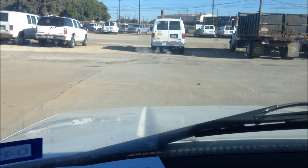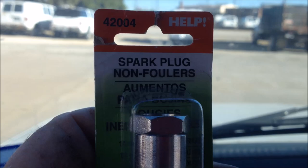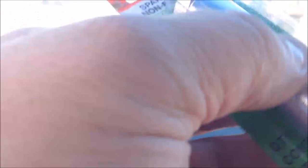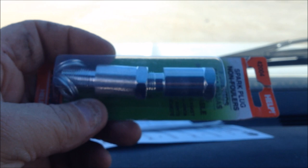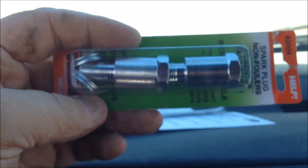This engine smokes like a freight train and I'm constantly having to go out and either clean the plugs or put new plugs in it. What we're gonna try — I've used these in the past — they're called spark plug non-foulers. This adapter screws down into the spark plug hole, then you screw the spark plug into the adapter. In the bottom of the adapter is a real small hole that allows the compression and fuel mixture to go up in there. The spark plug will still fire the mixture, but the contaminants of combustion — like when you're burning oil — are supposed to be kept off the tip of the spark plug.